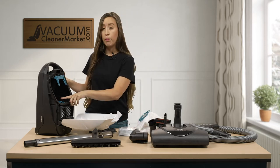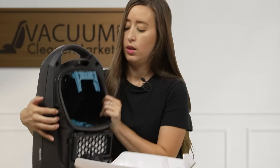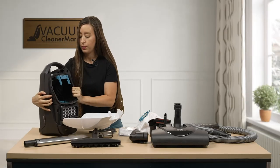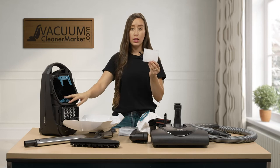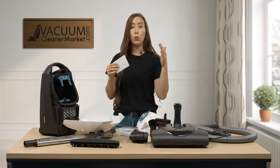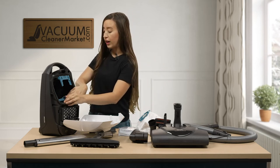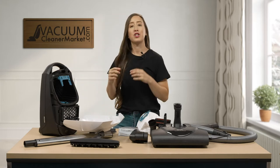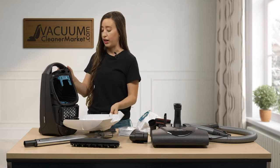I want to show you the motor filter on the inside of your canister. Pull down on that little blue grate and this houses your motor filter. This motor filter is to be changed every four vacuum bags, or every one box. It helps protect your motor, keeps your vacuum operating at full capacity, and actually extends the life of your motor. Changing your bags and filters is the simplest way of prolonging the life of your vacuum.